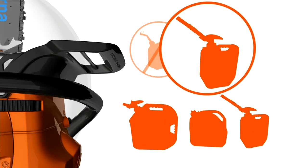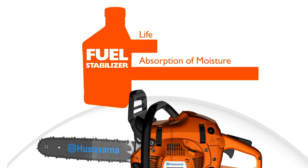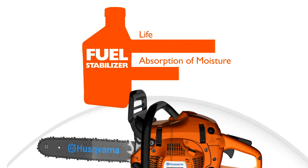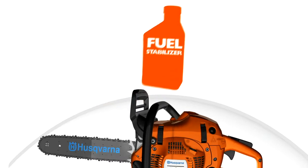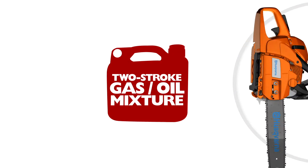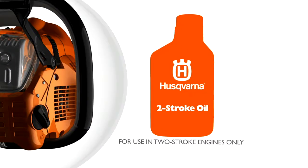These are examples of good gasoline containers. Fuel stabilizers can be helpful in extending the life of the product while also defending against the absorption of moisture. For maximum benefit, fuel stabilizers should be added to your gasoline at the time of purchase. While using a stabilizer extends the life of the gas, a two-stroke gas-oil mixture with a fuel stabilizer should not be stored for more than 90 days. Using Husqvarna two-stroke oil will help reduce the risk of engine failure and poor engine performance by helping to prevent the fuel from becoming stale.